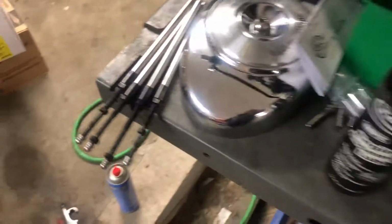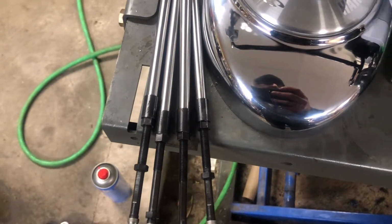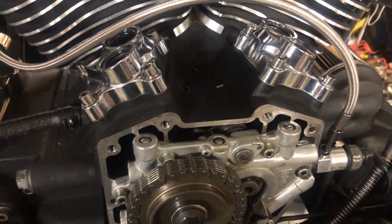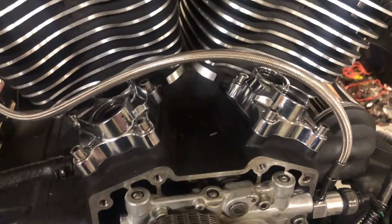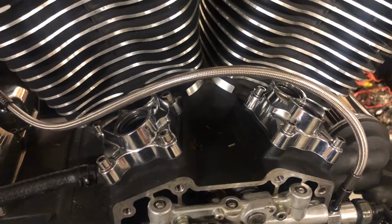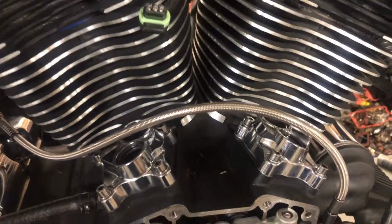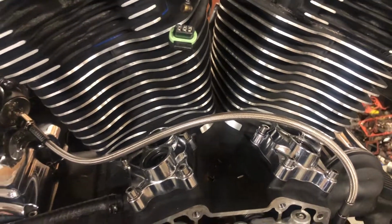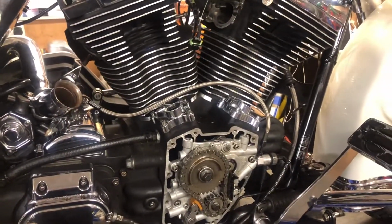So, with the quickie push rods, I just hold them up and open them up, so they're getting ready to get collapsed and stuffed in their holes. I've got both inlet valves, or should I say both cam lobes, off the follower, so there's no tension on both inlets. So I've got to do those two, then let the followers bleed down, and once they're free, we know they've got clearance, and we can start doing the exhaust ones in both of them. Because if we go too quick, we'll end up getting the valves tickling one another at the top, and I'll end up with a bent valve or something just to make my day complete. So we'll come back once we've got a bit further in.